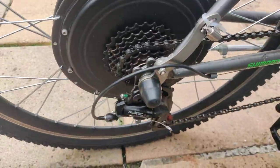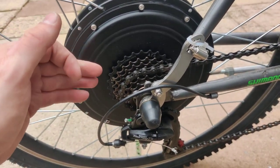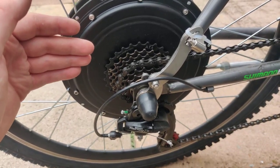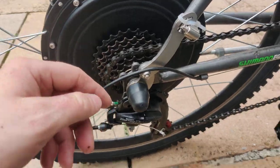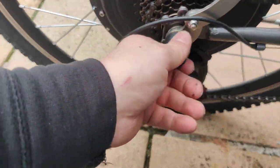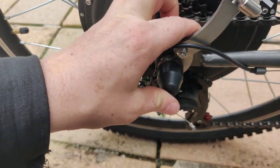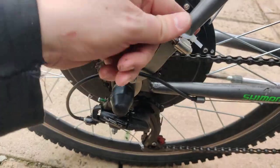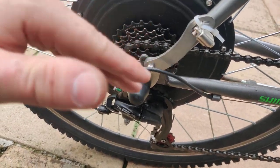It comes with a seven gear cassette. Originally this bike had a six gear cassette, but my dad accidentally caused it to fall apart, so we put the seven on and it worked perfectly fine. I'm using some spacers between the frame to stop rubbing, and rubber end caps as well. These bolts are massive, and I do recommend a torque arm for your frame — otherwise this motor will most definitely twist your bike frame.